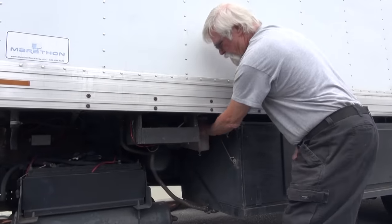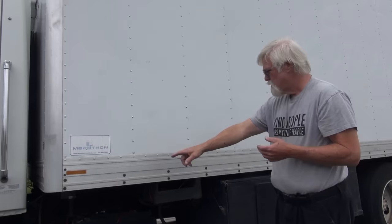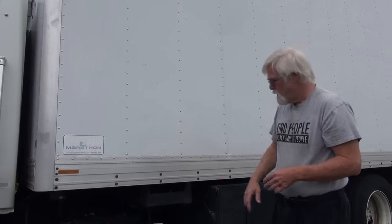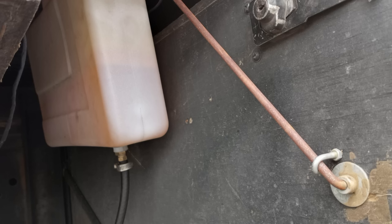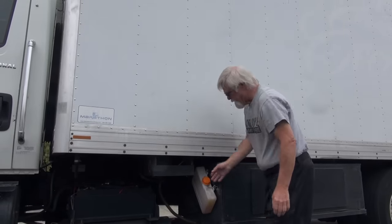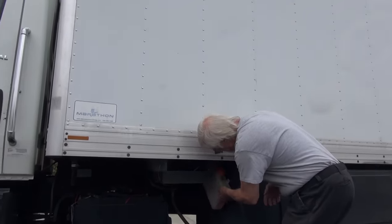In this compartment we have the Chinese diesel heater. At one point it stopped working because it was sucking gas out of the tank and was just a little too far away. We ended up bringing a diesel tank closer to it. I needed to be able to fill it, so I put it on a track — it slides down the track so you can fill it, then slides back up into place.